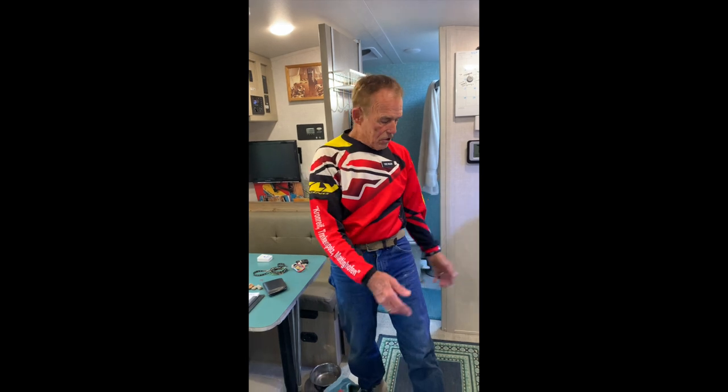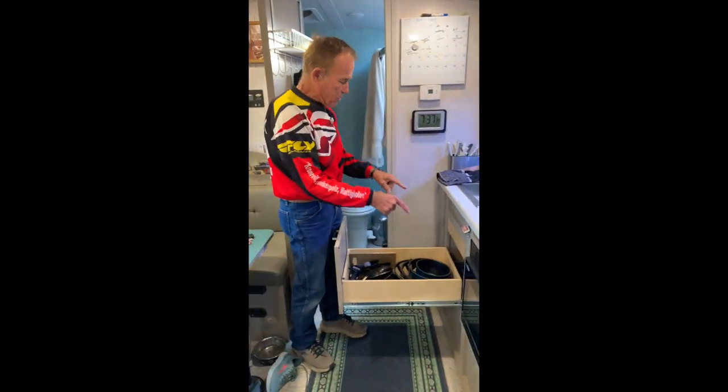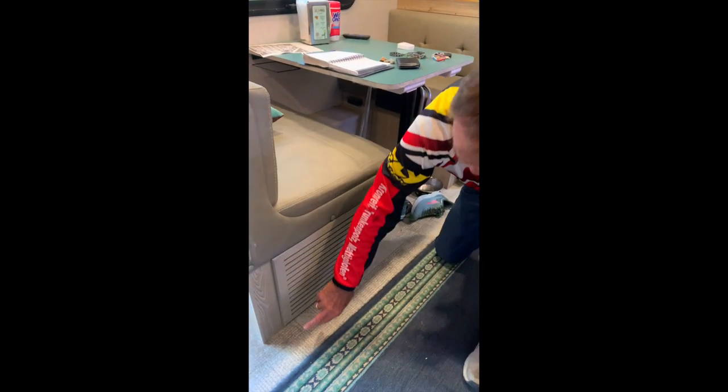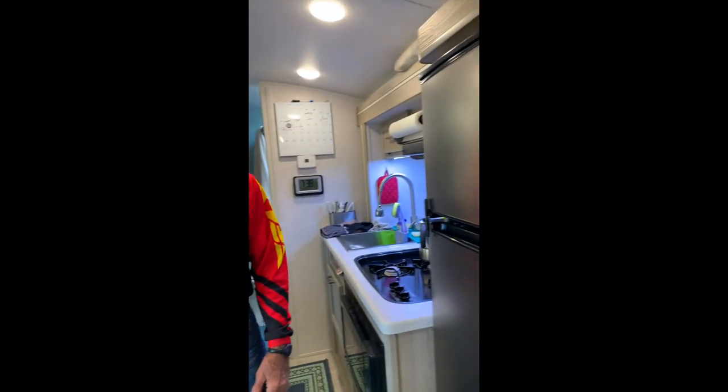So how much do you think you put into upgrades? Cost-wise, I don't know — $500. This part is a bit technical: you've got to put supports in the back and make sure it's squared because it's not perfectly square. This was screwed in with four screws — I took the screws out, put a hinge on it, and it had all this space underneath where the heater is. For the refrigerator, the only way to shut it off when stored is to go all the way to the front tongue and turn the battery off. So I just put a switch right here. It runs strictly on 12 volts. There's a 180-watt solar panel on the roof, and another one that plugs into the side of the trailer that we put outside.